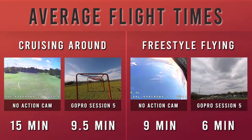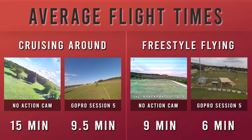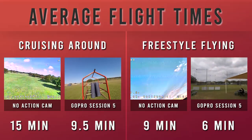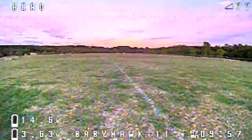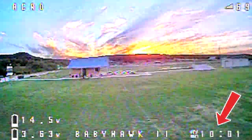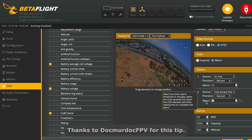Using the recommended 850mAh LiPo battery, I got some really impressive flight times. I noticed that my flight timer starts to blink after 10 minutes of flying. Since I don't need this warning, I turned it off in Betaflight by going to the OSD tab and setting the timer 2 alarm to 0.